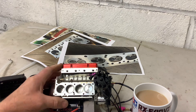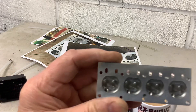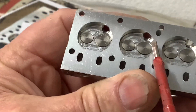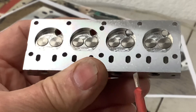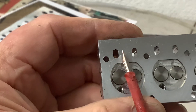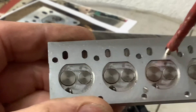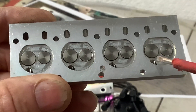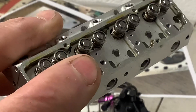I don't know where I'm going to go from this. I've cleaned the cylinder head up. You can see where the plugs come in — this is the head. Where these come in here, this is raised. Each one of these, you can see a little nick out of it on the top where the pushrod has been going in and out and catching on the back of that hole. The pushrods are rubbing on there, and the spark plugs when you screw them in raise it up because it's so thin. I'm really, really fed up about it.